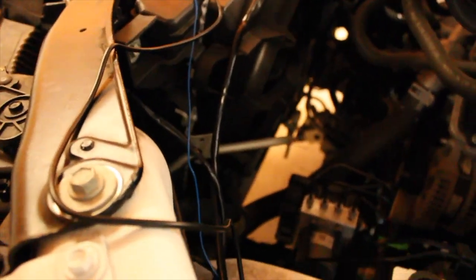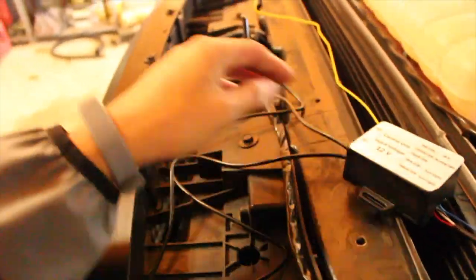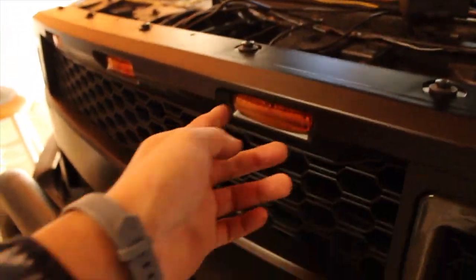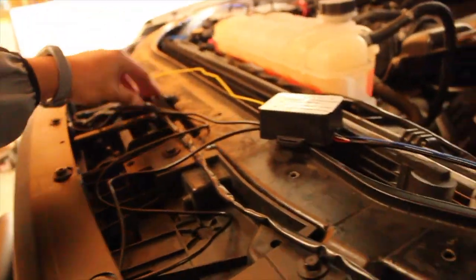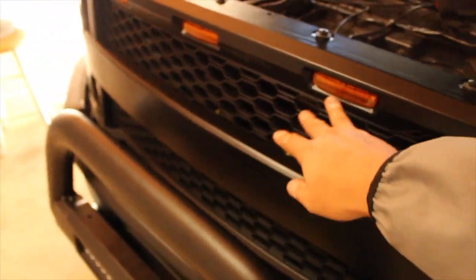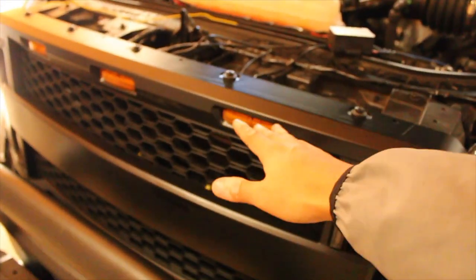So that is pretty much it for wiring guys — this is all included with the grille. You get the control unit, you get the top cable lights. The top amber grille lights are super easy to tap into — these go into your parking lights. I kind of fished it out and your parking lights are back here, it's super easy to splice into. And that's how you get the amber grille lights to function.